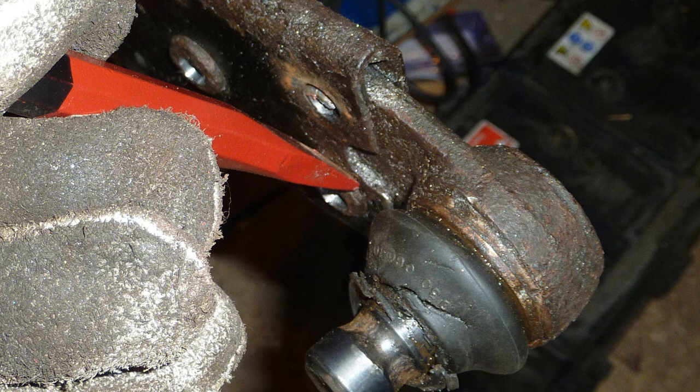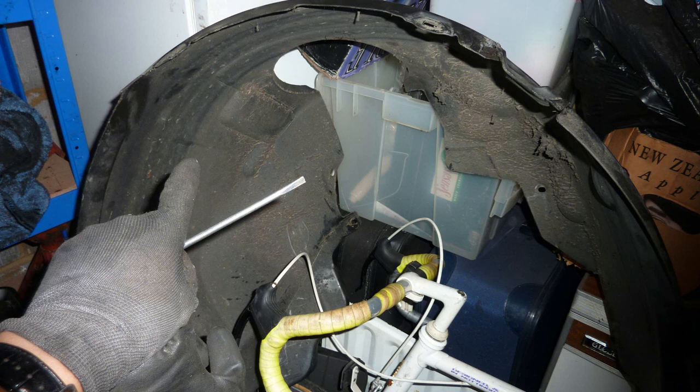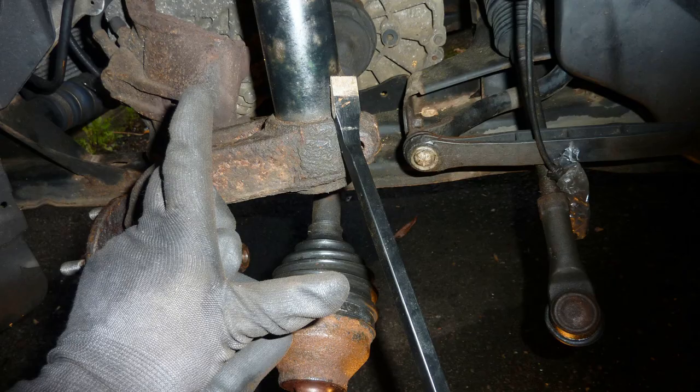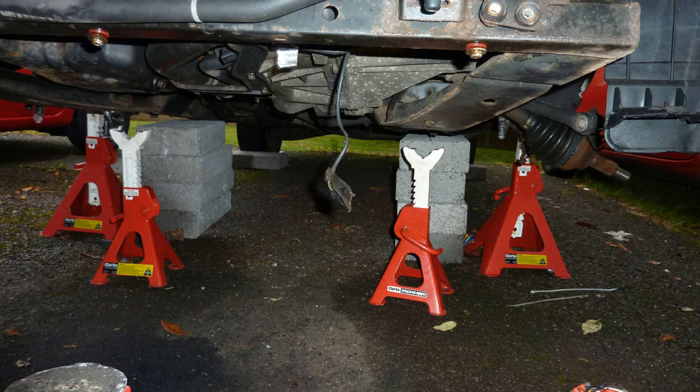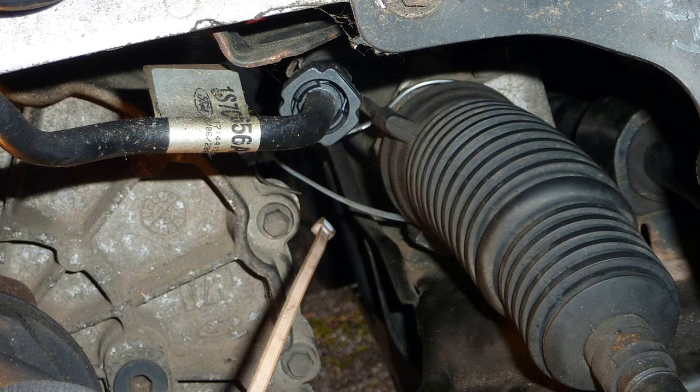They come riveted, so here I'm chiseling that thing off. Actually, how I did it was I laid it on the floor, drilled a smaller hole, then a bigger hole in it, and then chiseled it off. Okay, I'm trying to get that strut off. Notice I've got extra 1.5 ton jacks ready to take the subframe when it eventually comes off.